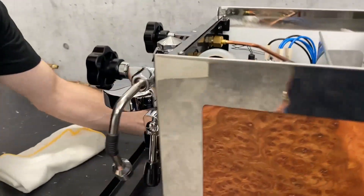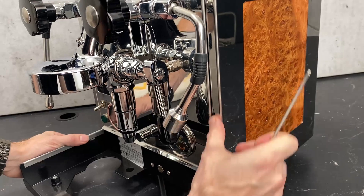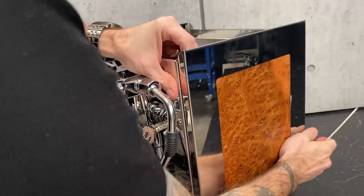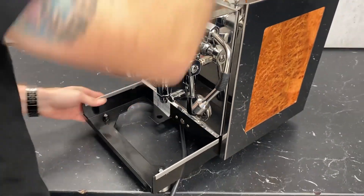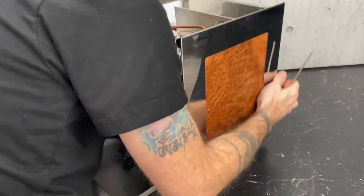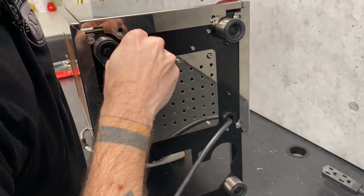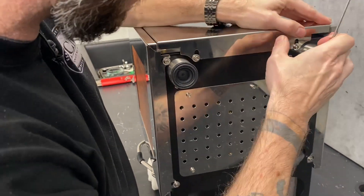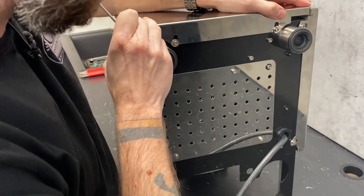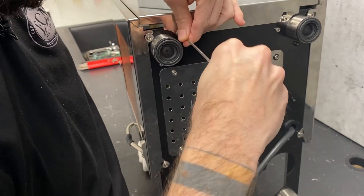The first thing I like to look for is right at the edge here — just to make sure that there's not a fat lip sticking out. It should be about the same all the way around. You can just give it a pull to make sure everything's fully seated in. Once you know that's all where you want it to be, you can go back and tighten everything down. If one gets a little off, loosen it just a little bit to bring it back — that's why I was saying don't over-tighten it.